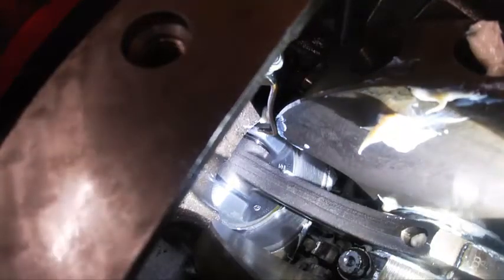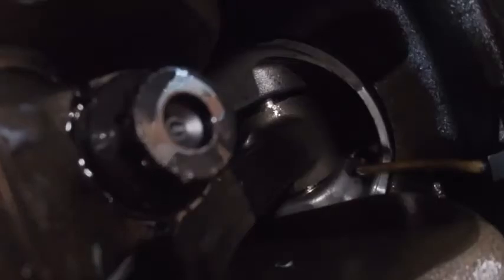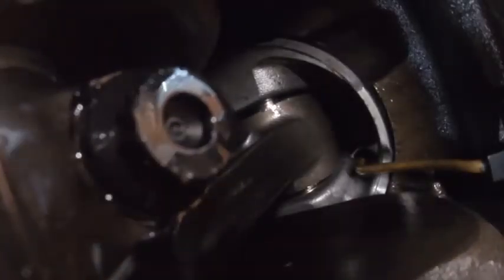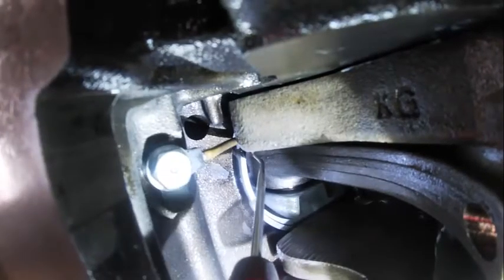If you look right here at this piston cooling nozzle, see how close that is to the crank weight — it would be very easy to knock one of those off if installed incorrectly. Right here is the cooling nozzle; see how that is directly in the center of that hole? You want it to be there on all of them. If it is not, it will destroy the engine. The cooling nozzle is directly in the center of the hole.